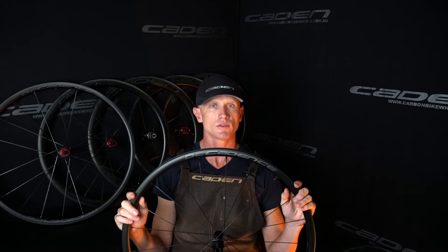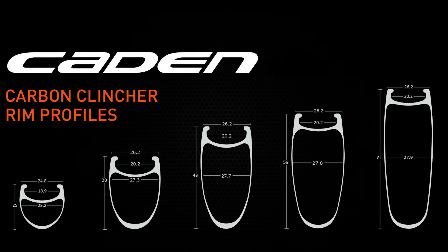Now I'm going to pull up a diagram of the rim profile with exact measurements so you can see what's going on with the width, internals, externals, and depth. Getting that rim profile right is just one part of the design process. The offset drilling in these is really critical too, to make sure the line of the spoke and the nipple is kept straight to the flange, with no bending of the final thread on the spoke itself, which is one of the weakest points. That rim profile has another diagram for the drill rig, which is all matched up.